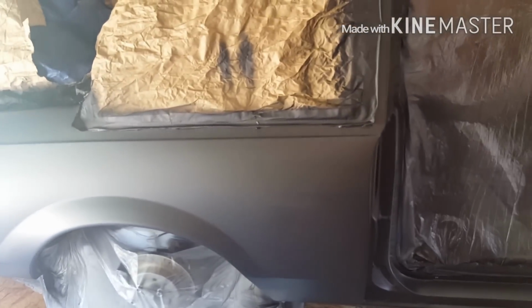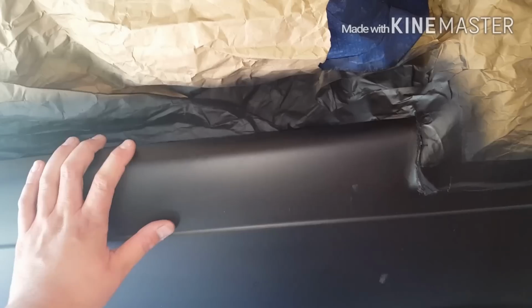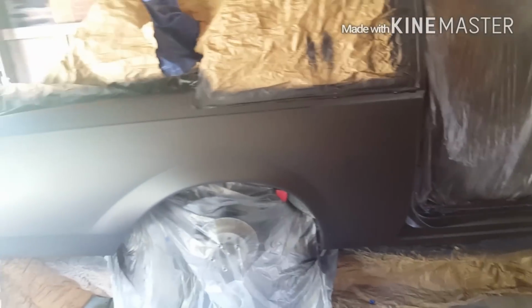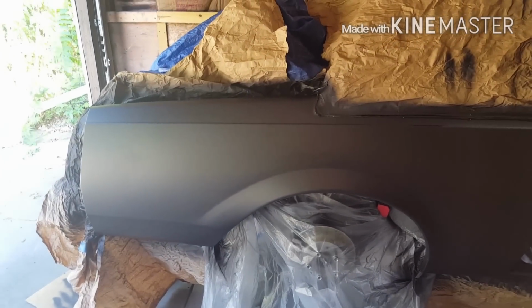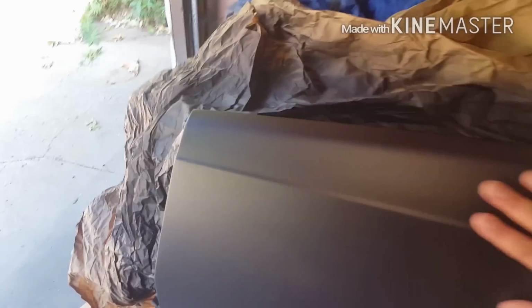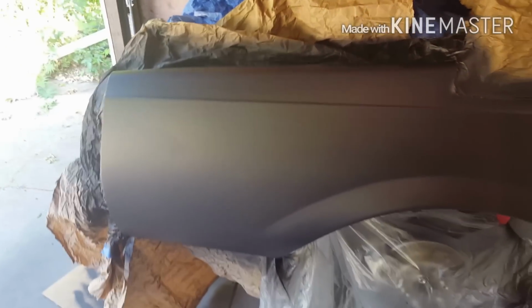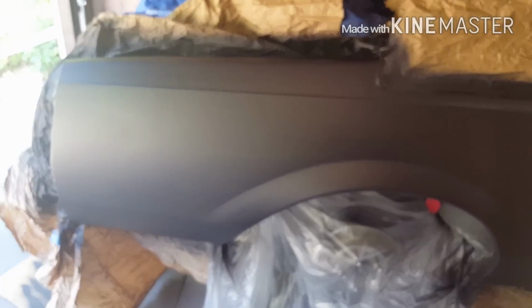So what we decided was we're basically just gonna shoot the rest of what I have as a sealer coat, which, whatever, that's what it's intended to be, but I just thought it'd be thicker. So we're basically gonna shoot the rest of the car with this and just run it as a sealer. And then I literally just got home from the auto body supply store here in town. They're gonna sell me some, I'm looking at just shooting some high build primer over this, which is the step you wanna go if you're making a perfect, nice paint job. But I need something that'll cover up some of the minor imperfections. So that's what we're gonna go with. I'm gonna get a high build. We're gonna shoot the high build over this. That way we can block the car down, make it nice and smooth. And then that's it. I think after that, we're just gonna shoot it with the regular body paint.